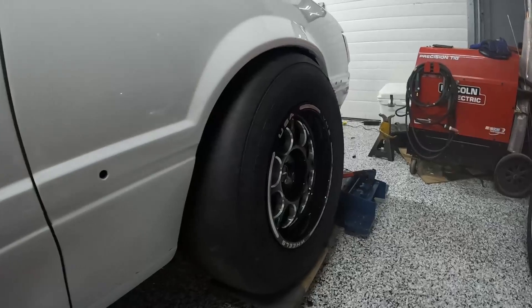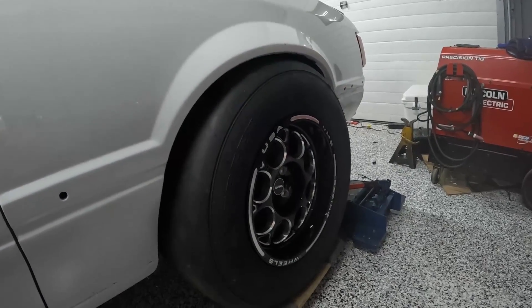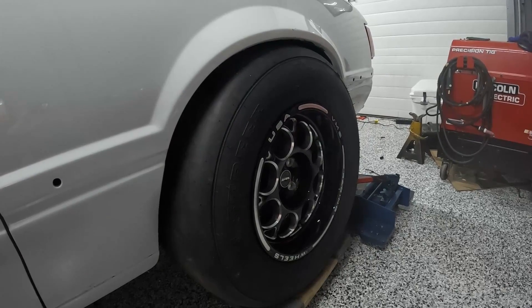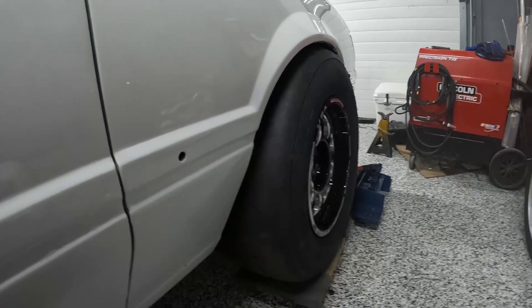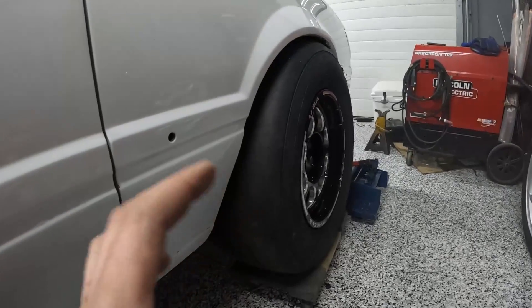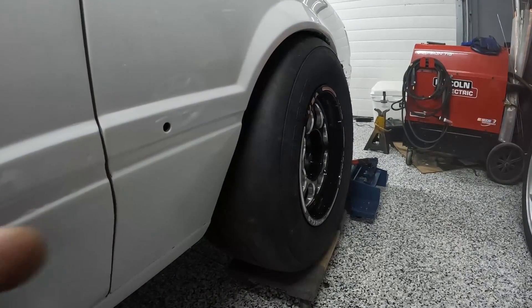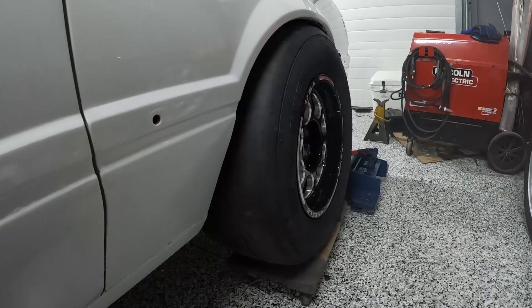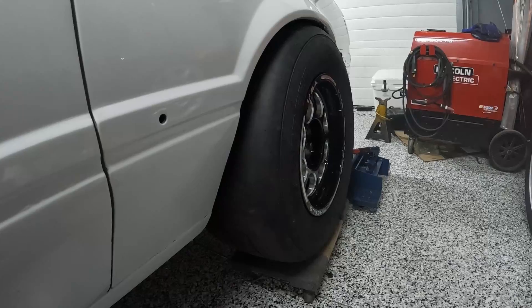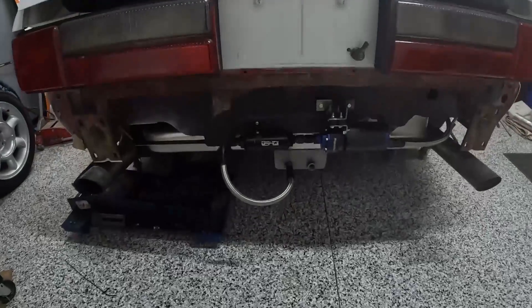Just a little sneak peek — I've got some new wheels and tires out back here. I'm trying to figure out why they don't fit very well, and I think ultimately I might have to narrow my diff. That's actually not the end of the world because I'm going to use Strange weld-on ends and Strange 35-spline internals in my axle, so narrowing it up isn't really a big issue since I already have to weld on it anyway.